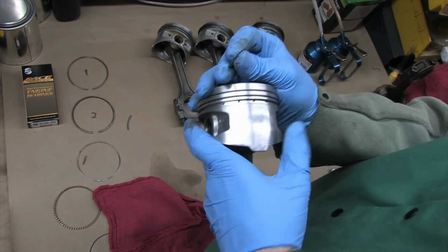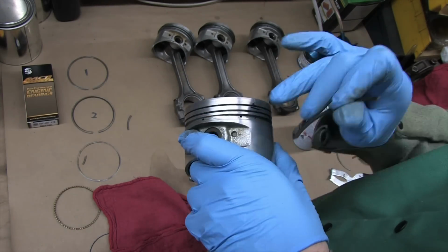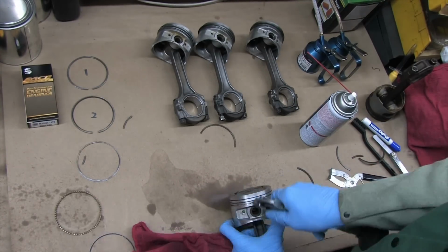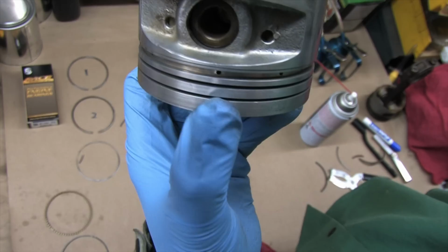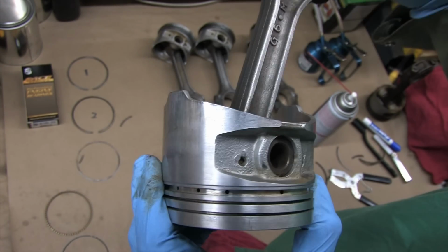The number 2 ring is thicker, and you can just as easily break off another one of your other spare rings. You only wish you had those ring groove pliers if you don't have any spare rings. Doing this manually is pretty much beginner level hand-eye coordination, and the results are always fantastic. Just be careful not to scratch up the piston. Look at these results.